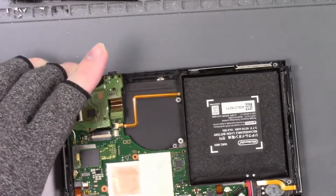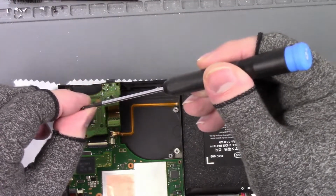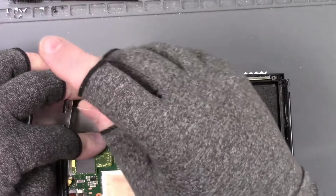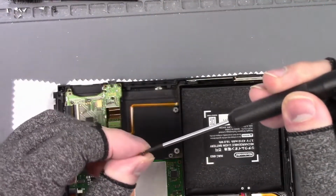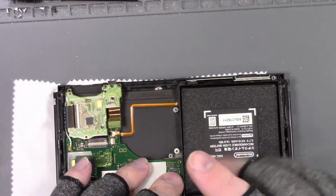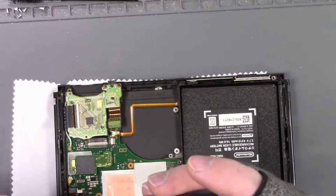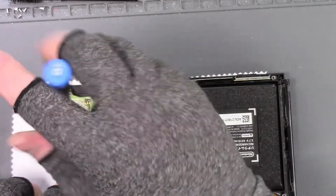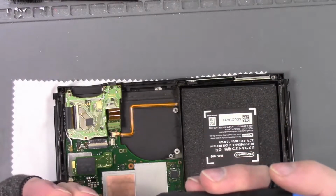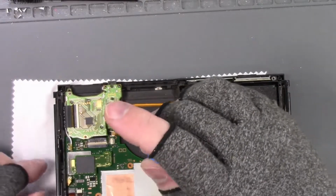Right, I'm going to put the screws in here. These motherboard screws in. So, when I realized that that pin wasn't connected, I thought it was just had flux on the filter and I couldn't make a connection. I should have just reflowed it again then, but I've already reflowed it twice and I didn't want to melt the port, but as you can see, I was able to reflow it again and hopefully all is good.